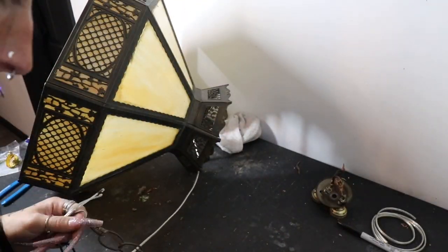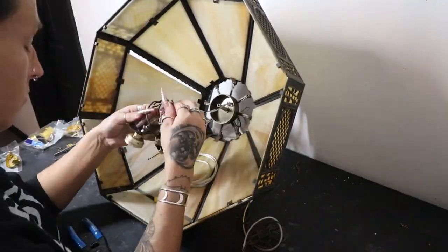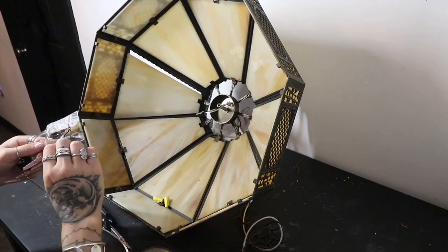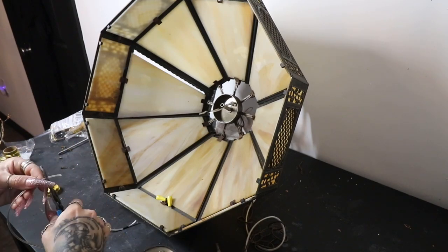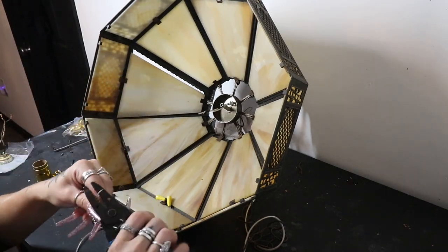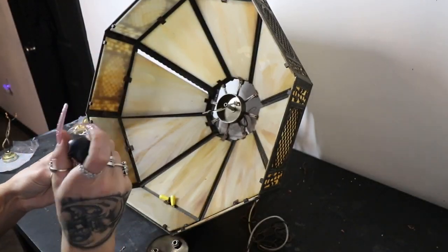As I'm doing this, I'm kind of cleaning up as I go since it's an older lamp. I've got this new wire in, and I'm designating one side black and one side white because we're going to need to know which side is which for when we attach our new light bulb fixtures, but also so when we put it back into the ceiling, we know which side is which. Now we're working on the actual light bulb fixtures. We have to cut maybe six-inch wire pieces to attach to our new light bulb fixtures. Each light bulb fixture will have a bronze or copper screw and one silver screw. Your copper screws are going to be your black, silver will be your white.